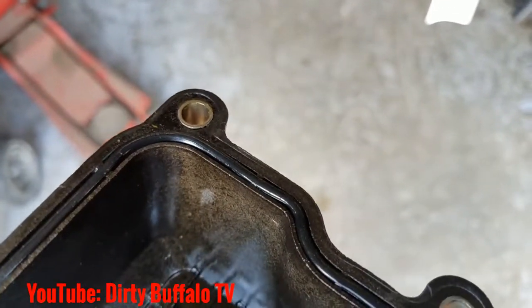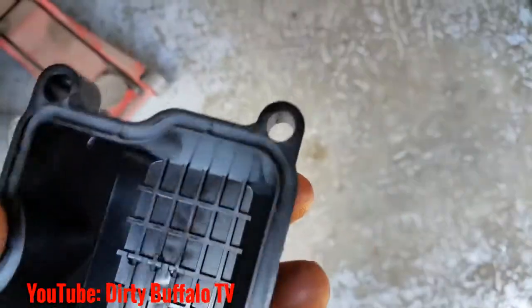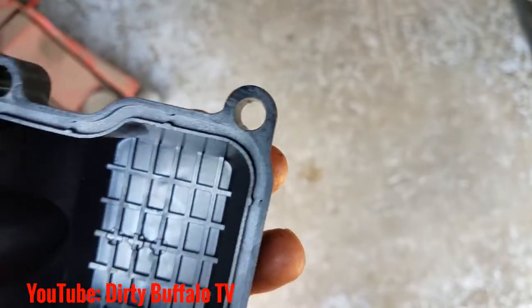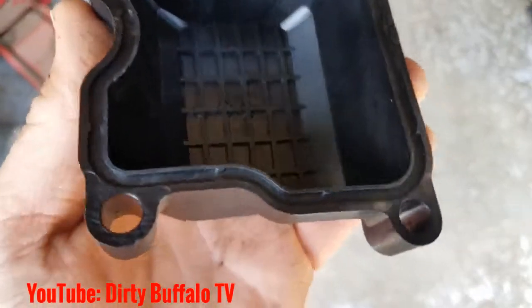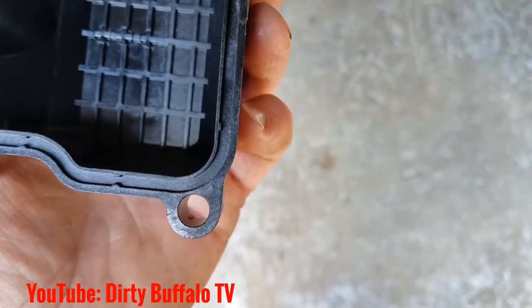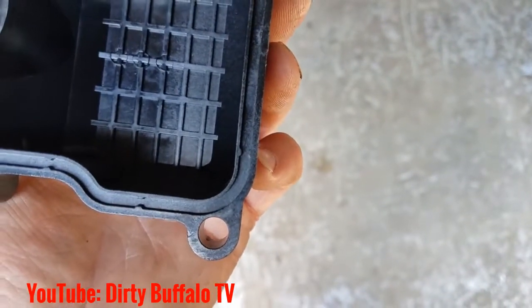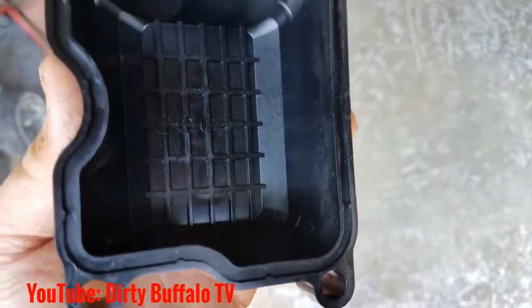You can see it again on this corner. It doesn't matter what you put on there — o-ring or gasket — that valve cover is junk. Here you can see a good one: nice flush mating surface all the way around. Even though these have the o-ring groove cut in them, you can still use the gasket. It'll seal up and work just fine, saving you money over time because you won't have to replace the valve covers, gaskets, or o-rings as soon.